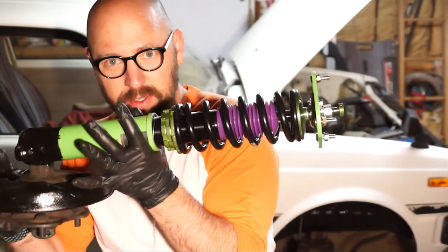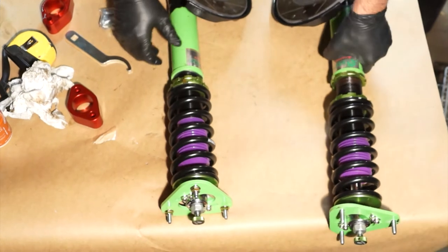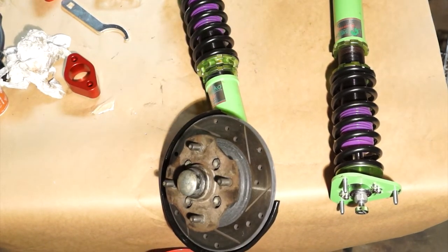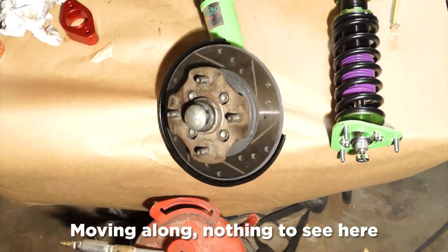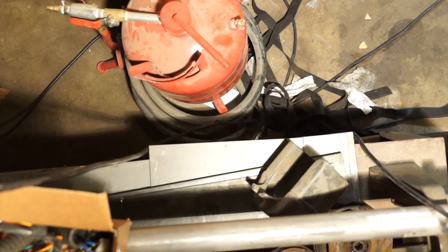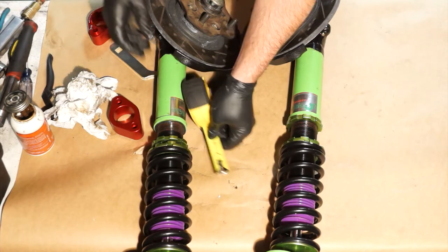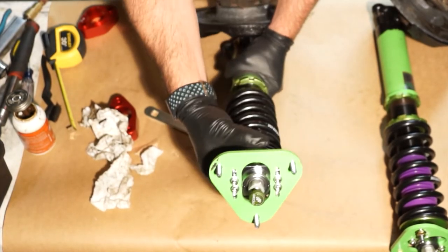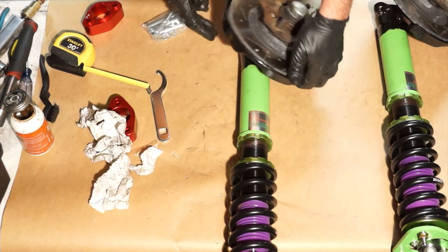I'm going to adjust this other coilover. I've got the one set where I want it. This one is currently bottomed all the way out. I'm measuring from here to here. These two rings are locked in, springs preloaded. I just need them to match — we've got two inches here. So I'm going to back this one out by spinning the whole assembly. It's locked in at two inches. I've got this one set up at two inches. It needs to be pointing away from the spindle so that as it rocks in and out, the one bolt is toward the engine away from the spindle, because that's how it is in the car. Line it in at two inches — and that's all locked in.